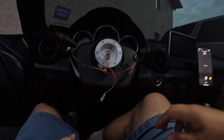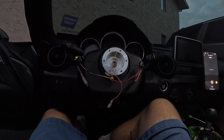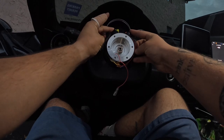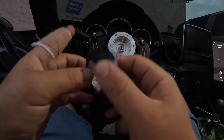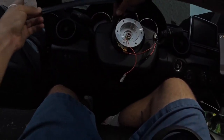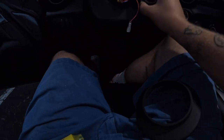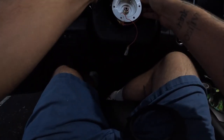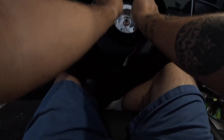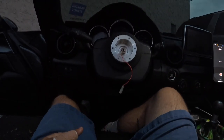Now that you've got your airbag resistors on there, what I've seen a lot of people do is put a little bit of tape to hold them in place right there. Got that all taped up — what that does is help the wires not rattle while you're driving. Now just get this plastic piece on, everything's taped up and looks nice.